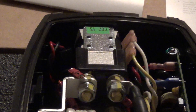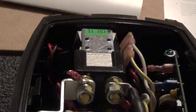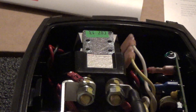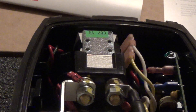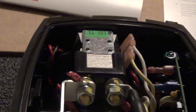The contactor — when you plug the car in and the signal is sent to start the flow of power, this contactor closes, thus allowing the flow of power. I was able to read on the side — this is made by Curtis. It looks like it might be manufactured in New York, and not one of Curtis's China models. Curtis is well known for their electric car motor controllers and other DC and AC powered motor controllers. I can attest to the quality of their components — I use their motor controllers in my conversion cars, namely my Alfa Romeos that I convert. Based on previous experience, that is a very high quality component.